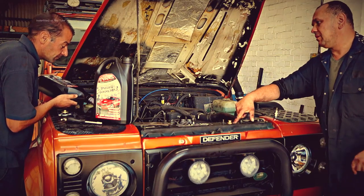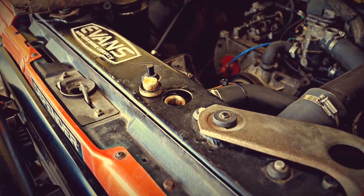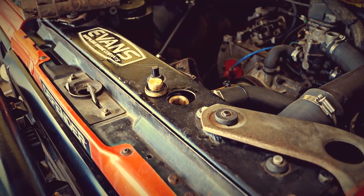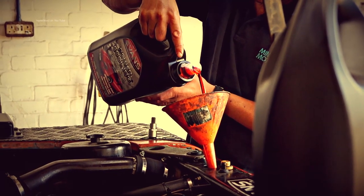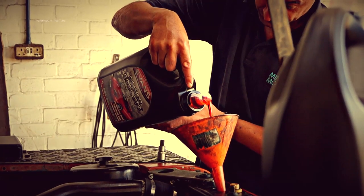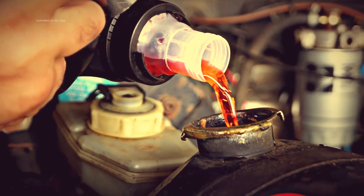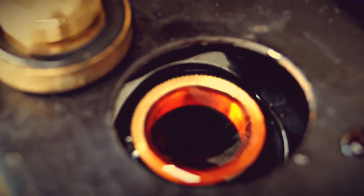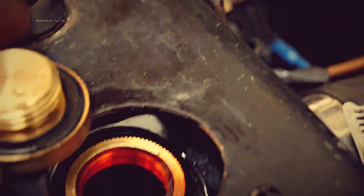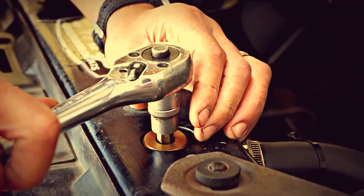Okay, so it's a matter of just putting the fresh fluid in and topping it up, making sure there's no air in the system. With a radiator, quite commonly there's a bung on the top which will let your air out. This is also a convenient way of filling the radiator and the engine up to level quite quickly. Using the expansion tank to fill it up, and once it's come to the level at the top of the bung on the radiator, it can then be capped off — either by socket or in this case an allen key.